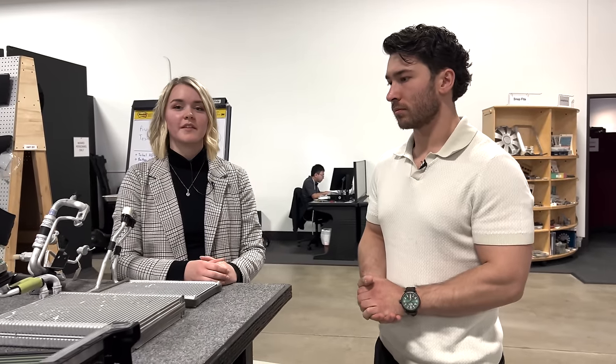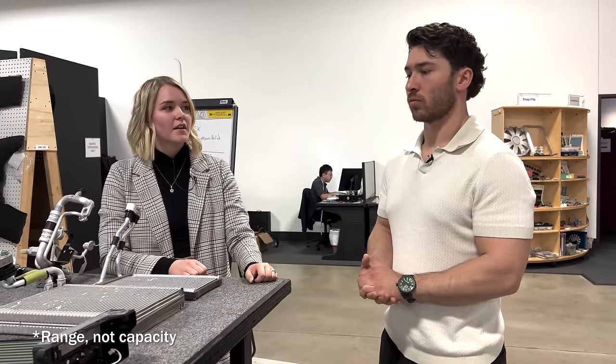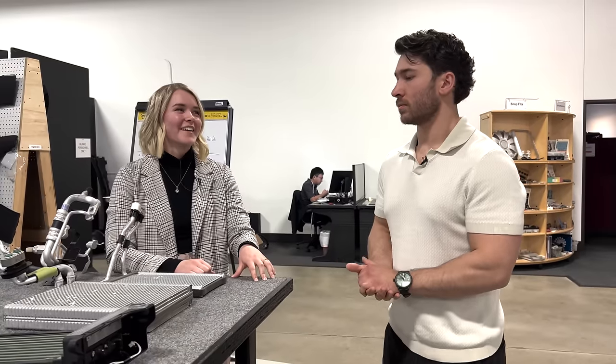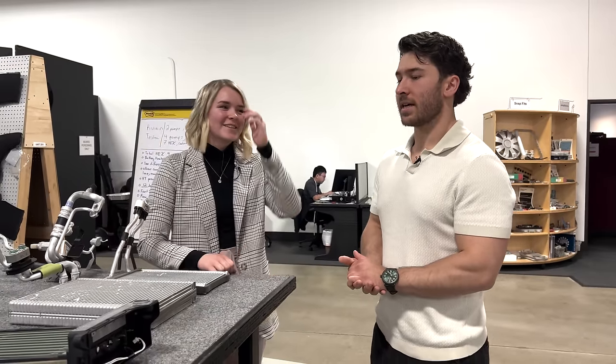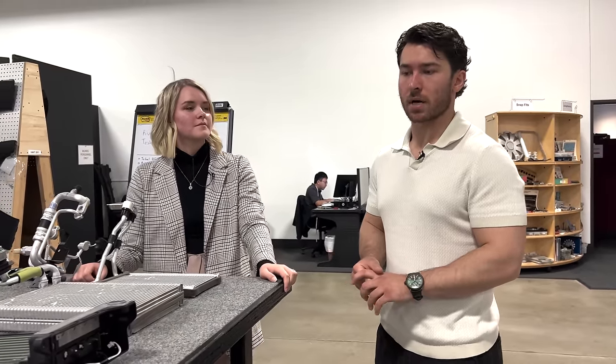Yeah, it is definitely a best of both worlds thing, because PTC heaters, because they're high voltage components, directly impact your battery capacity. Right. So at first when I saw that there were two heating elements within the system, I was like, oh no. It's a balance between performance and efficiency, and definitely what they have set up here is likely for what their internal requirements are for cabin heating. It seems to be, it's a compromise for sure, yeah. But ultimately it's one that's not going to cost them too much.